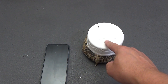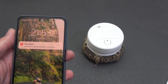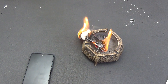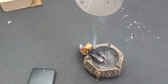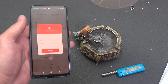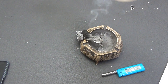We'll run a self-test. Press the test button for 2 seconds — as you can hear, the siren is triggered and the LED indicator starts flashing rapidly. Press the test button again to turn the siren off. A notification immediately arrived on the smartphone, and quite quickly. The test passed successfully. Now let's simulate smoke. I light and extinguish a piece of paper and hold the detector above it. After waiting for sufficient smoke concentration, there's a trigger — the siren is loudly sounding, the LED indicator is flashing, and a push notification arrived on the smartphone. This detector responds not to open flame, as it is not temperature-based, but to smoke — when the sensor sees smoke particles, there will be an alarm. Therefore it should not be placed directly above the kitchen stove, as there may be false alarms.